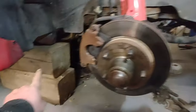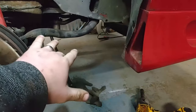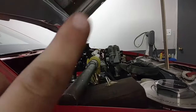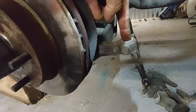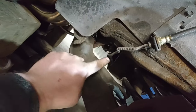Here we are working on the car — you can see I got it propped up so the front end is completely suspended. I got the engine propped up off the motor mounts and some support under the transmission, with a little rod going across with a strap holding the engine up. I took off the tie rod end here because this A-arm and all of this structure right here — this, this, and that under there — that's all got to come out.